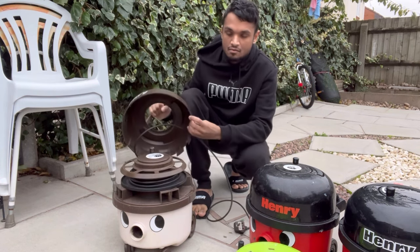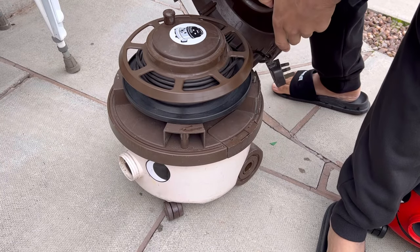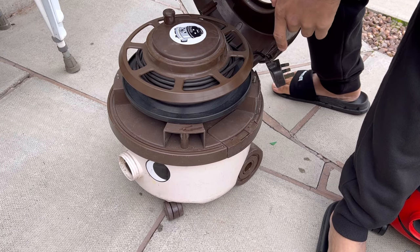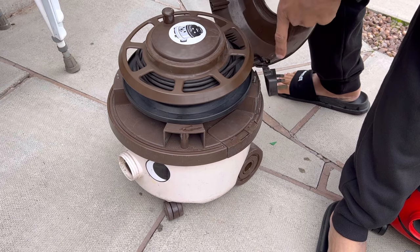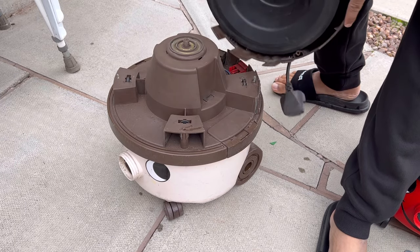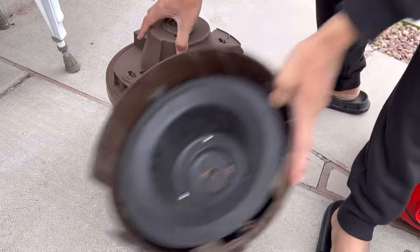Because the glue melted, the screws won't hold anymore. When I picked it up the motor housing came loose and now it won't go back in again. The glue modification wasn't a bad idea, but using it bagless made the motor heat up and melt the glue — that was misuse — and as a result it just doesn't hold together anymore.